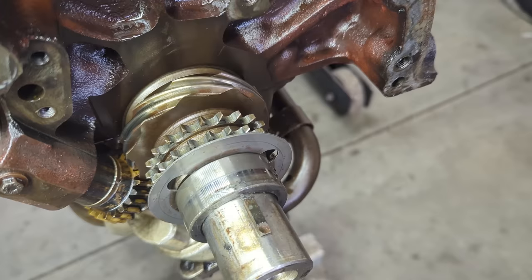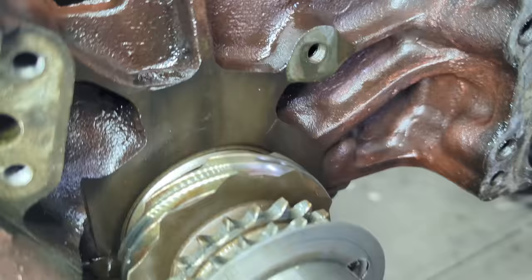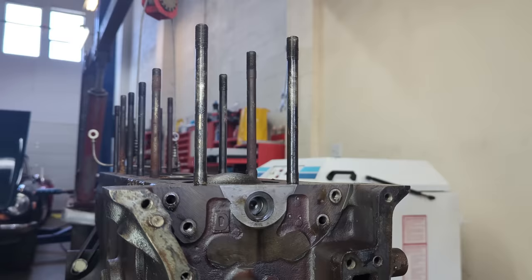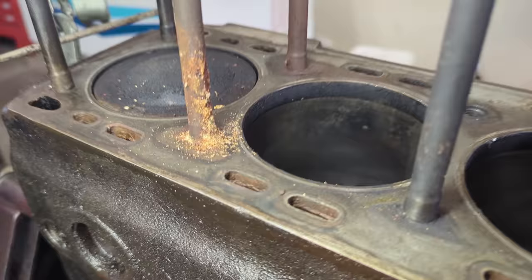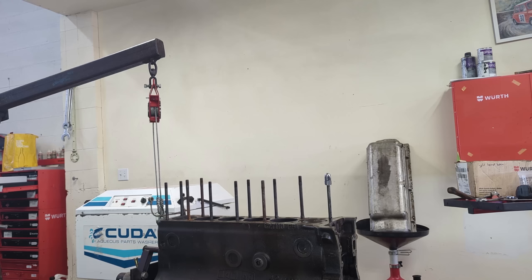Here at the end of the crankshaft — that's the distance piece, which we always replace because that's a seal surface. Having a look at the sprockets, they do show a little side-loading wear. Definitely getting a new sprocket for the crankshaft. The next task I'm not really looking forward to are these cylinder head studs. I'm going to use the double-nut technique, work my way to this corroded one and then start recording. Looks pretty corroded — give me a minute.